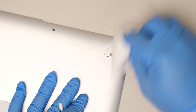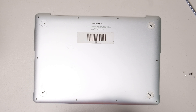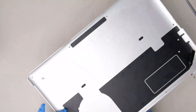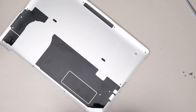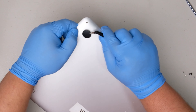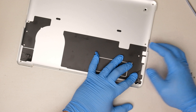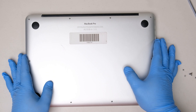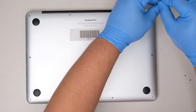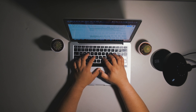After it is cleaned, wipe the area and allow the alcohol to dry. Now let's attach the new rubber feet. Peel the replacement foot from the plastic cover and using tweezers, guide the rubber foot inside the cavity. Make sure that the foot is lined up with the small hole near the perimeter of the pad. Do this on all of the sides that you need to replace. Now put the black sticker on the inner part of the backplate, although it doesn't stick as much as before. Don't forget to wipe any dirt off the back cover. Then align the cover at the back of the MacBook — once you hear a click, that means it is in place. Put back all the screws and we now have brand new rubber feet.